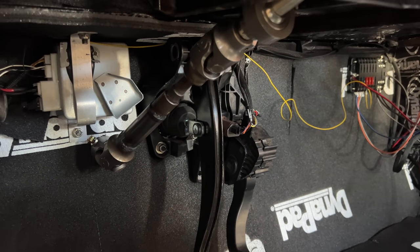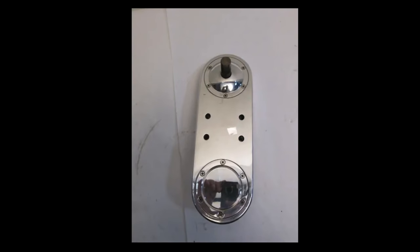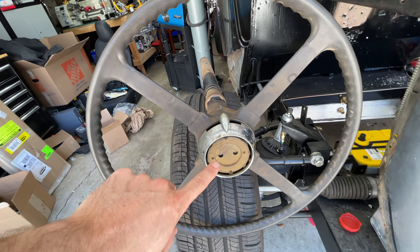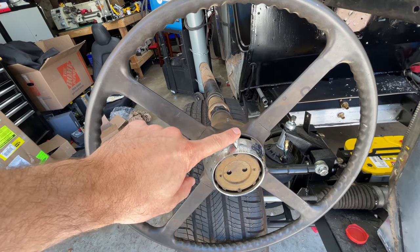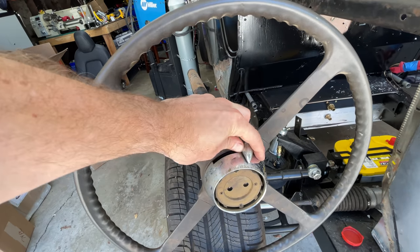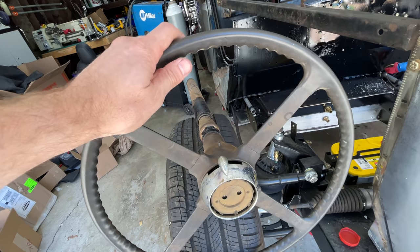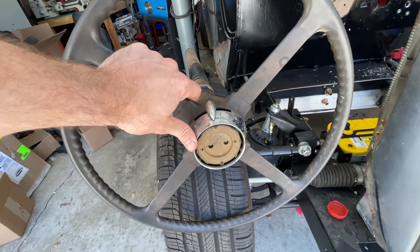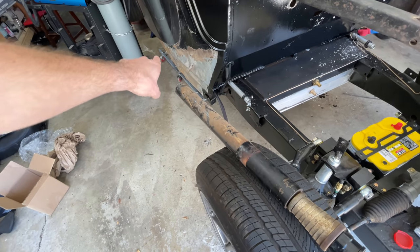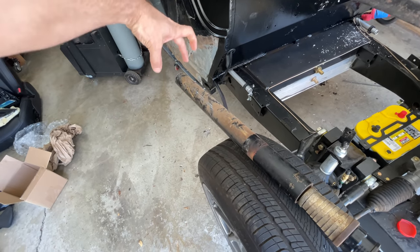I'm going to make a steering drop box. You see these on old hot rods sometimes — it takes the steering input and sends it down a foot or so using chains or gears or something. I'm going to make one, but with a unique twist. This car originally came with a cool turn signal switch in the center of the steering wheel. You flip the switch left and it turns the left turn signal on, and as you rotate the wheel back it auto-cancels. The cool thing is it doesn't rotate with the wheel — the switch is always at the top. They could do this because the steering column is straight all the way from the wheel down to the steering box. Inside the steering shaft, there is a smaller shaft that's constrained at the steering box and holds the center part from rotating.